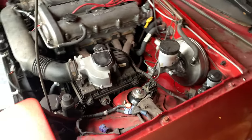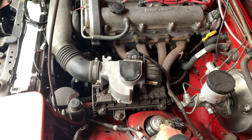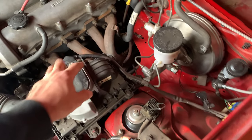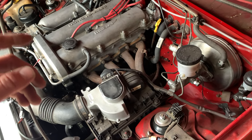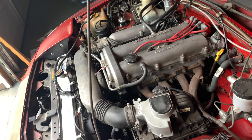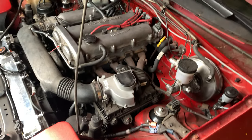Let's talk about what I've done so far to diagnose this pile of junk. I tested that the fuel pump works — I jumped the fuel pump circuit on the diagnostic connector and the fuel pump does spin up. It spins up and the car still starts up and dies. I also checked the airflow meter — I held the flap open and the fuel pump cycles. Again, starts up and dies. I tested compression in all the cylinders. Number two was a little bit low at around 130–135 psi, but all the others were at 155 or even 160, so it's not compression related.